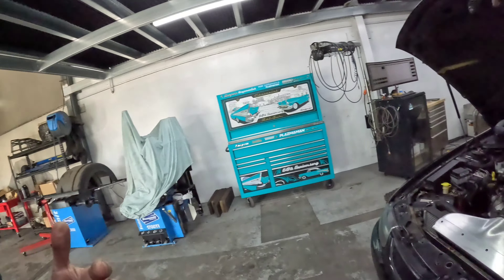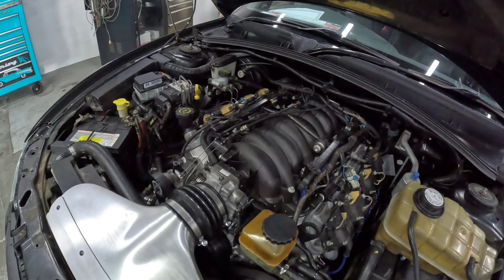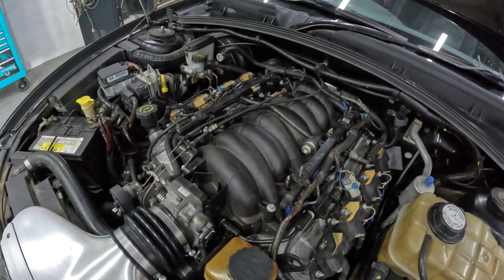The smaller manifold does give you better bottom-end torque and better throttle response off the bottom, but in the top end it chokes up, so the power on this car is going to be a little bit less than what we'd traditionally do. A good upgrade for this customer would be to put the LS6 inlet manifold on it — it's a completely direct fit, you can just bolt it straight on.